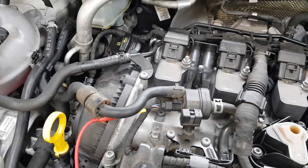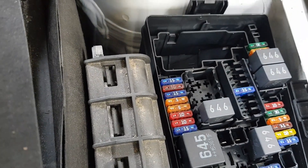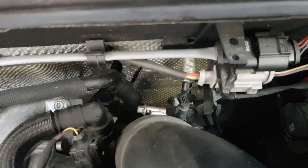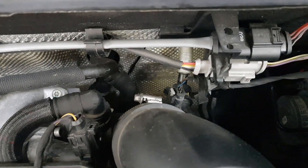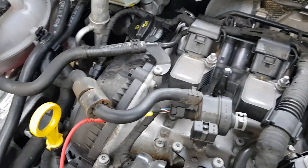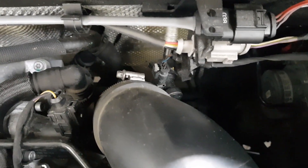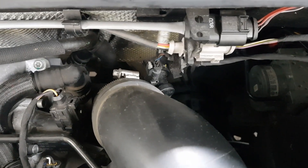And then that should be this sorted. Just a blown fuse which was stopping it, but obviously fuses blow for a reason, and the reason was that pump down the back. So yeah, we got there in the end. Maybe I should have checked the voltage and seen the fuse blown first, but we still would have ended up in the same place — disconnecting each component to work out which one's shorted. Thanks for watching guys, come along to the next one.